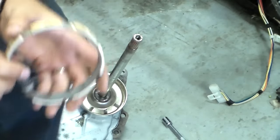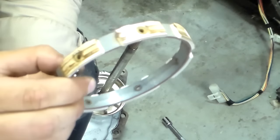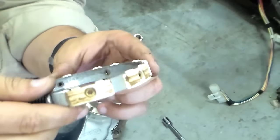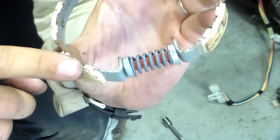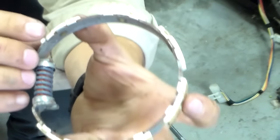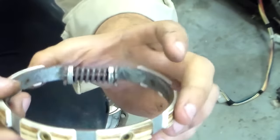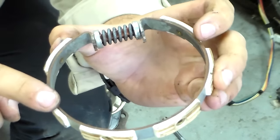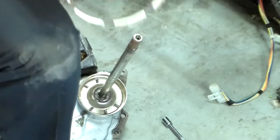And this is what the actual clutch bands look like. You have got all these white pads that grip the side of that. Now there is a bottom side and a top side to this. So when you put the new one in, the bottom is going to have the little nubs and the top is going to be smooth. You want to make sure the two smooth sides are facing up when you put the new one back in.